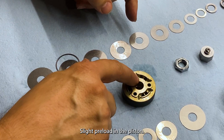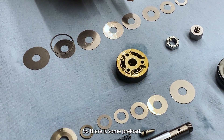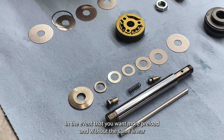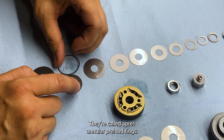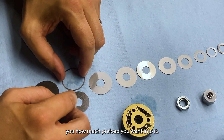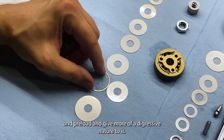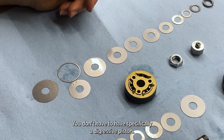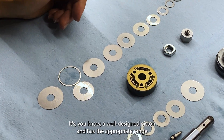The piston and the valving have a slight preload — it's got like a half-degree taper to it into the center, so there is some preload, which gives you a little bit of a digressive nature to it. But it is a linear piston, so it's kind of a combo. In the event that you want more preload without the same linear rate, you can add these — they're called APR rings, annular preload rings. This has a certain thickness and you just shim how much preload you want into it, and then the stack above this as it's clamped down will deflect and preload, giving more of a digressive nature.